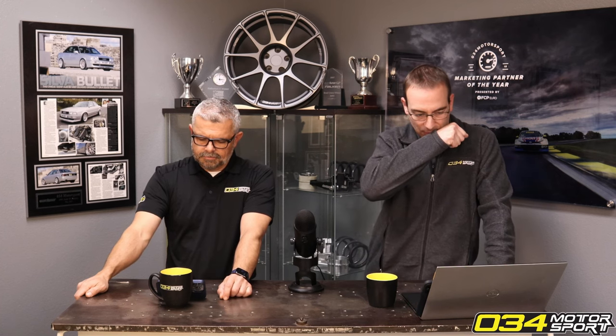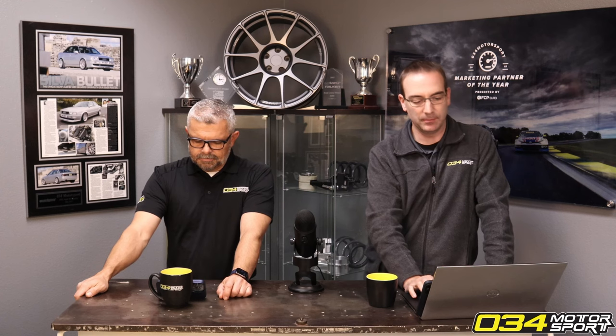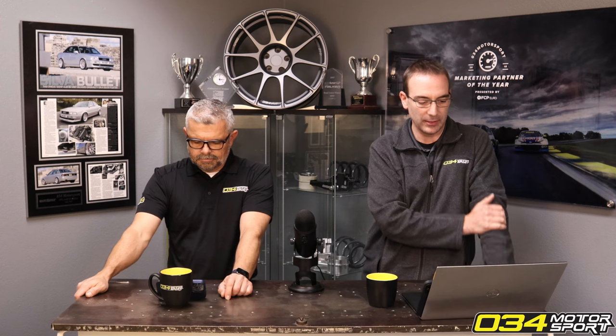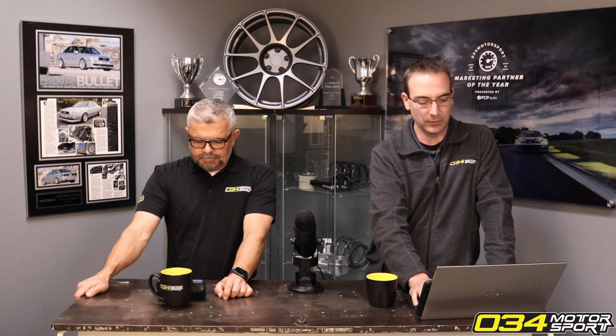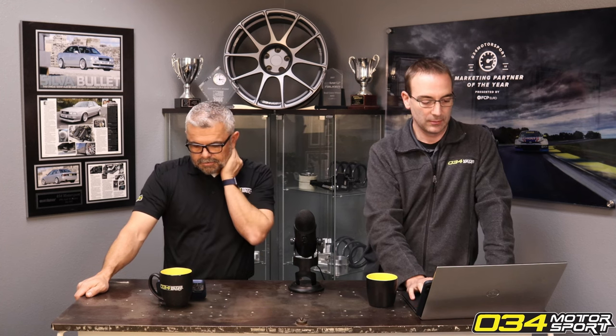It really depends how you're driving this thing. If you're on track with it doing this, or you're really spirited driving, maybe your traction control and stability control stuff might be grabbing a lot of rear brake. Rear brakes are almost never an issue with these. Our discs will fare better — whether it'll unequivocally solve your problem, we don't know what's causing it, we can't really say for sure.